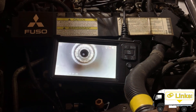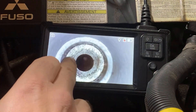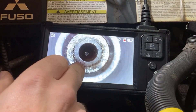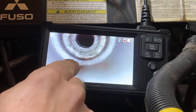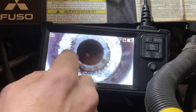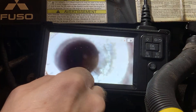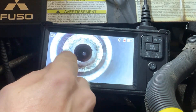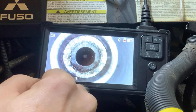If you don't have one, I highly recommend getting yourself one of these little boroscope cameras — they're not expensive at all, and the things that you can see. This is the base of the bore where the injector sits, and really it just sits on this inner ring here. I can see a little bit of carbon there and another piece here. There are a couple spots around here where it's a little bit dirty. This inner ring here is what needs to be cleaned up, and that's what we're going to try and do next.